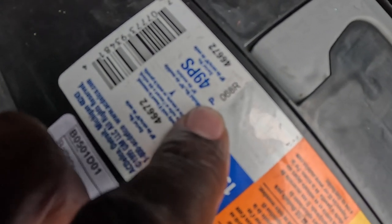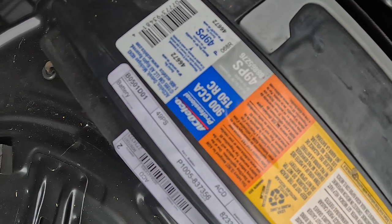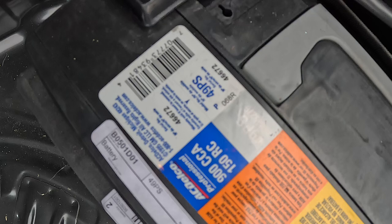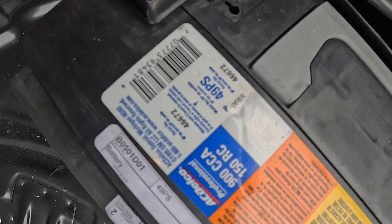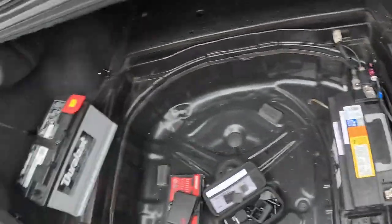The date code is usually a four-letter slash number combination code. In this case mine starts with a P, so my date code is going to be 0-6-8-R. The six stands for the month the battery was released, and the eight stands for the year. So this is telling me the battery was put in this vehicle in June of 2018. We are in 2024, so that means this battery is almost seven years old.